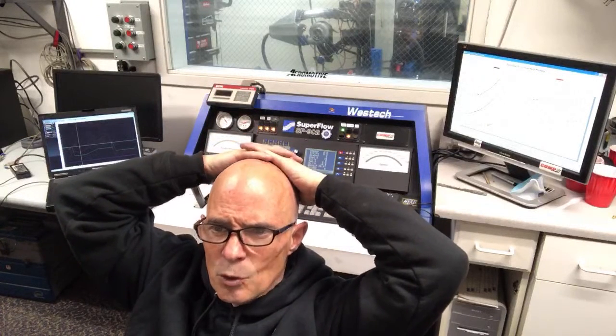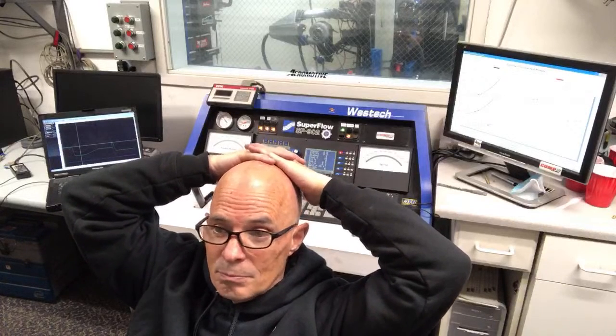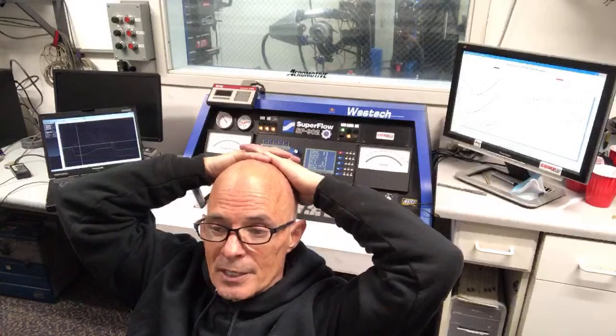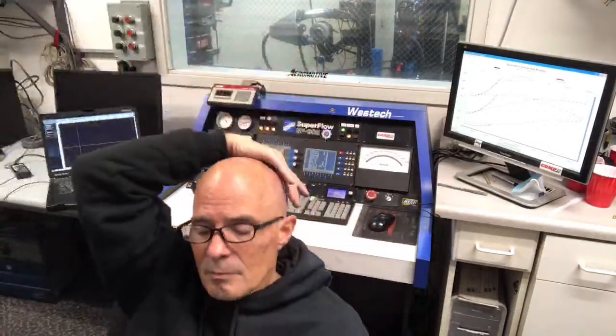You can inject the fuel on top of the blower, and you can't use stock injectors. You have to use the injector size for whatever power output you have, but you can run them on top. And actually on top, it will be much more beneficial. Because the 671 or an 871, whichever, I can't remember which one it was, is going to want to have fuel going through it, and it's going to cool things off a lot. Freiberg has his motor here, and they tested that. It worked really good.